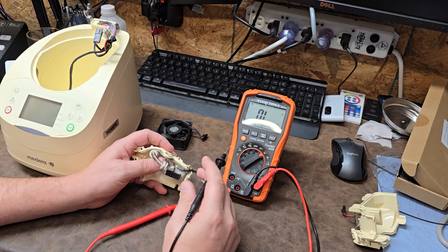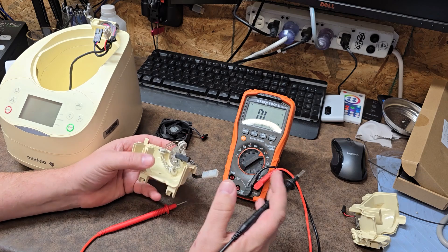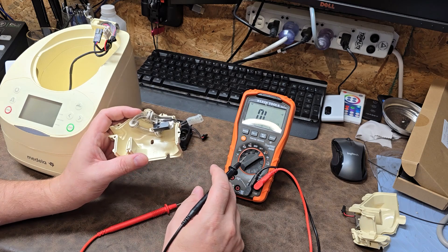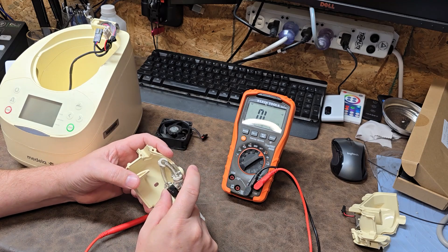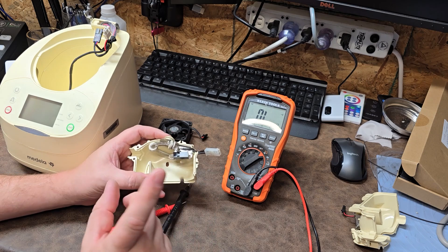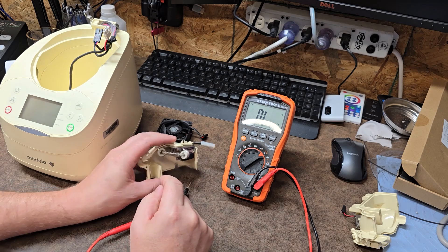As I've said in other videos, the heating element should be all on or all off, which means if it was correct it should be at about 40 ohms. It's sitting at six ohms - that's fascinating. It looks brand new. I checked with other units and they are supposed to be six ohms. That means this little guy heats up very quickly - it's got very low resistance in that heating element, and it pulses: it uses pulse width modulation to heat up this heating element.